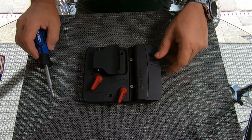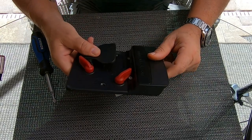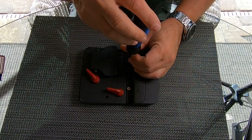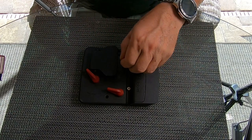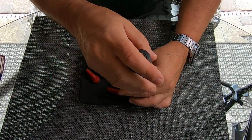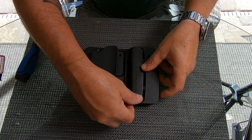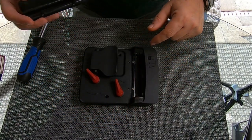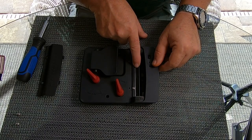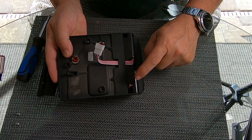This is the inside paddle of the door lock, and this is where we're going to start. This is the battery compartment and it simply comes off with two screws. Then we can slide forward and remove it — this is where you insert your four batteries. Inside there are two smaller screws that will allow me to take out the battery compartment, which is this plastic piece, and the PCB board is inside here.